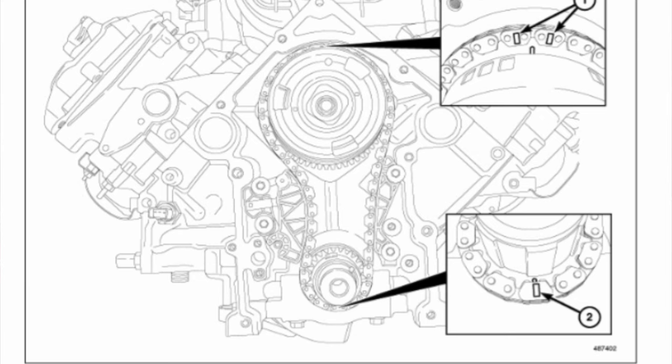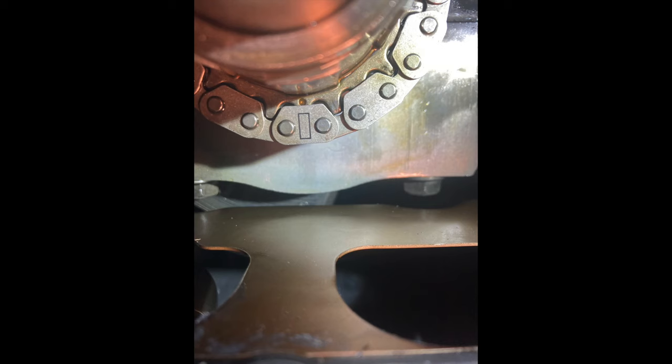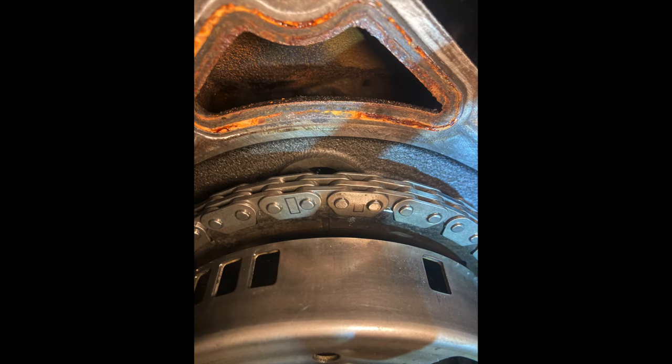So I pulled everything off the front of the motor again, went back in there, lifted the motor, pulled the oil pump, went through all that, and made sure the timing was exactly right. As you see here, this is the Mopar chart to follow to set the timing — it's a very simple motor to time if you can see all the hash marks and the marks on the sprocket. I went back, verified all that, and put everything back on the front of the motor again. I then went to start it again — same thing. It still wasn't idling.